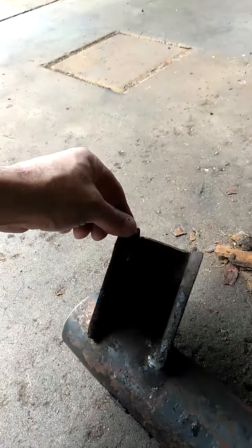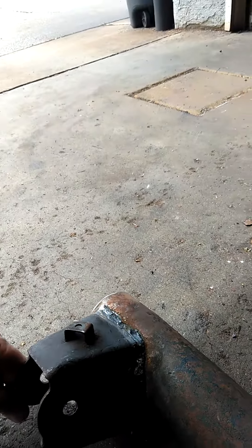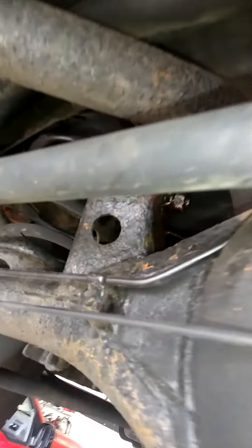So don't throw these cars out — don't send them to the junkyard. This is an easy fix, especially for me. Here's the perch on this side. This side over here, because they didn't fix it right, that whole perch is ripped out. I'll actually repair that perch assembly too — I'll plate it on both sides and it'll be good as new.